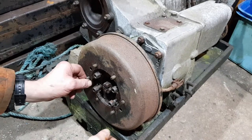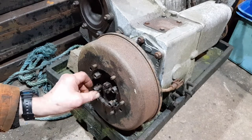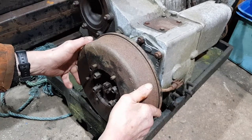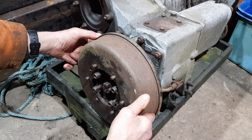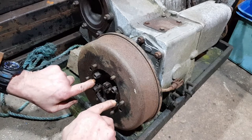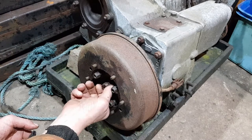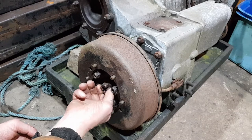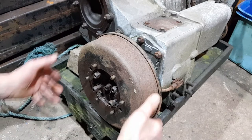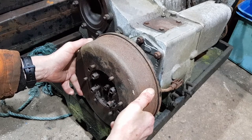After loosening the brake nuts and taking them off, I bagged them and wrote on it — I might be a bit anal, but that's just me. You start at the back to dismantle. Brake drum needs to come off. After backing off the adjuster, this needs to come away. This has been mated with the output shaft for quite some time and doesn't want to move. We've already cracked this nut — take that off and the washer, and you bring the brake drum off with the output shaft mount as well.